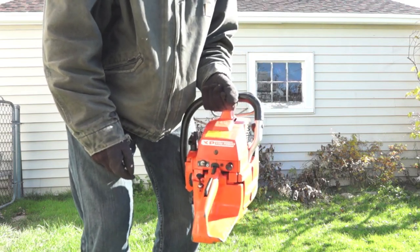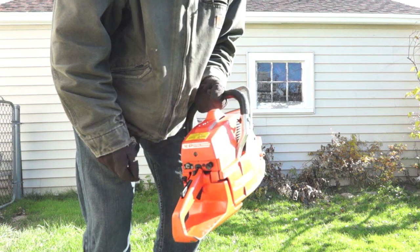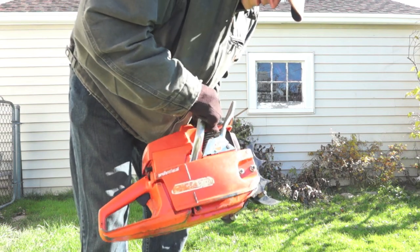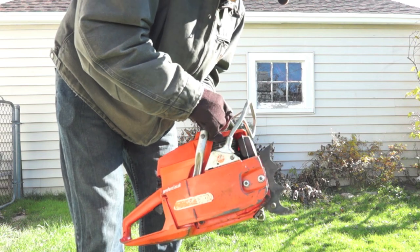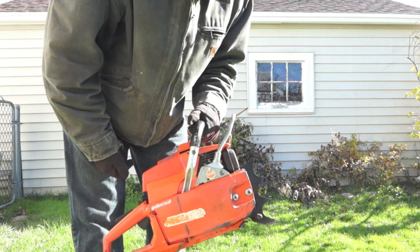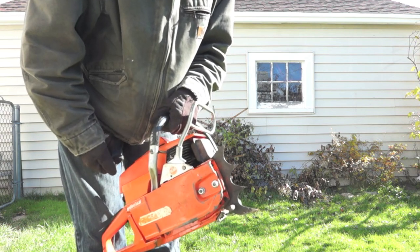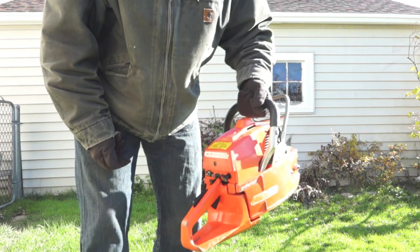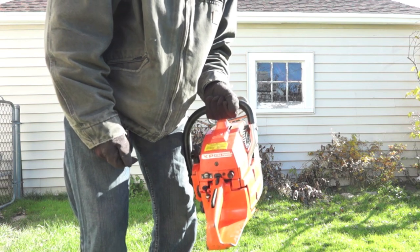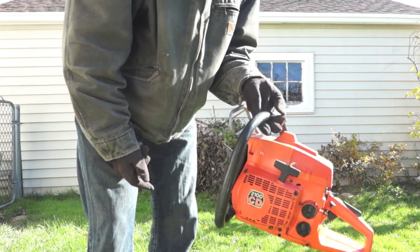I couldn't afford a brand new 100cc saw, so this is pretty sweet. The reason I got it was for milling — I'd like to do some milling at the cabin. I'm getting a little blowout over here; I'm assuming it's because I don't have the muffler bolt in. There's also no gasket on the muffler, and the little metal plates that go in between the blade — none of those, so I gotta pick some of those up. Beast of a saw — I never had a 100cc saw before. Look forward to future videos, probably next year when I'll take it out for doing some milling. That's it for now. Thanks for watching.